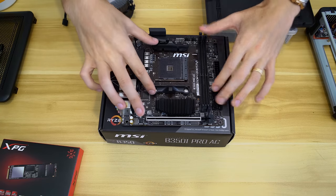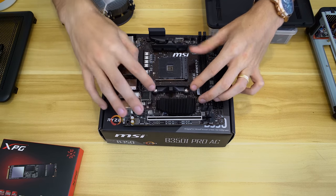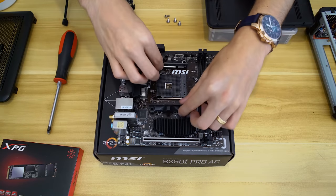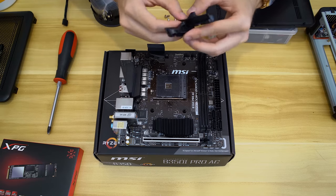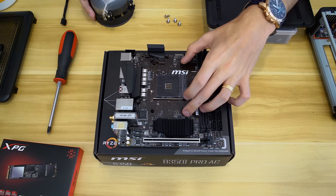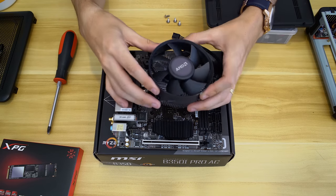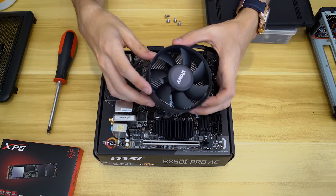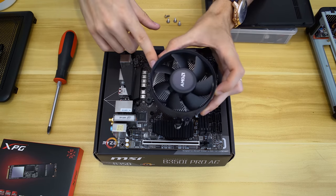We'll pull out the board and place it on top of the box as a makeshift workbench — we don't want to work directly on the table surface. We're going to remove these retention clips because the stock Ryzen Wraith Stealth cooler we're using won't require them. Take your Phillips head screwdriver and remove these four Phillips screws; save those in either the CPU box or your motherboard box. Also, our CPU cooler by default won't fit in the Antec case, so I had to remove the plastic outer ring with the AMD logo — more info on that in the video description.